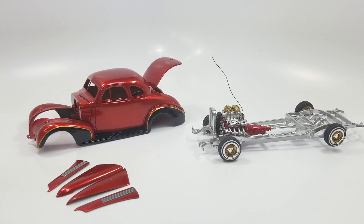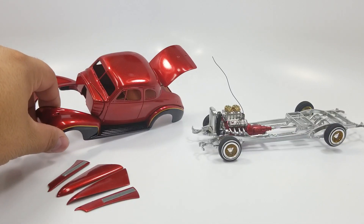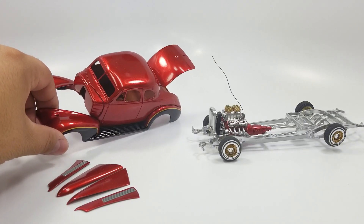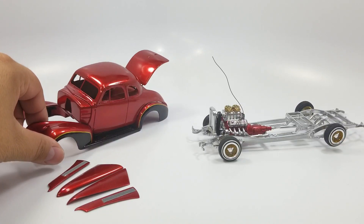This is where I'm at so far. I still have to cut the clear on the body — that's the first coat of clear. I gotta cut it, then shoot a flow coat on it, then cut it again and buff it out. As you can see it's not the greatest finish, but that's just the first coat. The clear coat always looks like that on my first coats. I think my hardener was going bad or something.